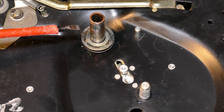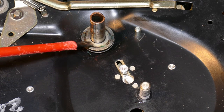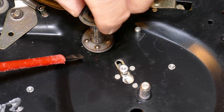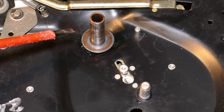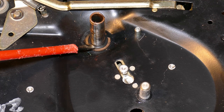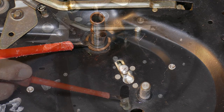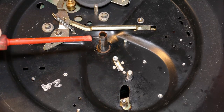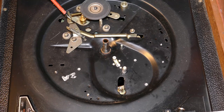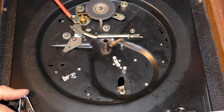Now we've revealed the central spindle for the platter and the spindle that carries the cam. Around the central spindle is a ball race. You can see the mark from the original rubber cushion that sat on top of that plate — that's perished away so we're going to have to replace it. The cam follower should rotate freely on its own little spindle but it's pretty much jammed, so we're going to have to free that up. The other important area is the linkages between the controls and the idler wheel and motor drive — they all seem quite free, so don't envisage much problems there other than a little bit of lubrication where required.